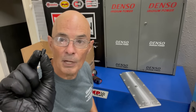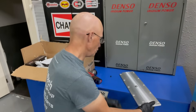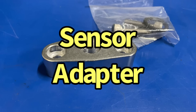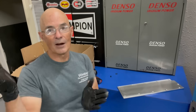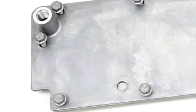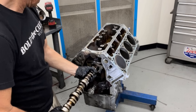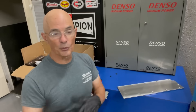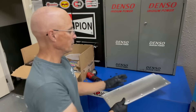There are basically three things we can use to do that. Brian Tooley sells these little plugs, and I'm going to show you where they go in the lifter valley. We can plug the holes that bleed that oil pressure off. You can also use a different valley cover, like this very cool ICT billet one — it has provisions for O-rings and covers up those holes so it doesn't allow oil pressure to bleed away from the lifter. GM also makes a direct replacement valley cover, but you have to take the cylinder heads off to access the lifters. There are eight DOD lifters, and at least those eight need to be replaced — if it's high-mileage, probably a good idea to replace all 16. Put standard lifters in with standard lifter trays, install a good performance camshaft, and get rid of DOD.